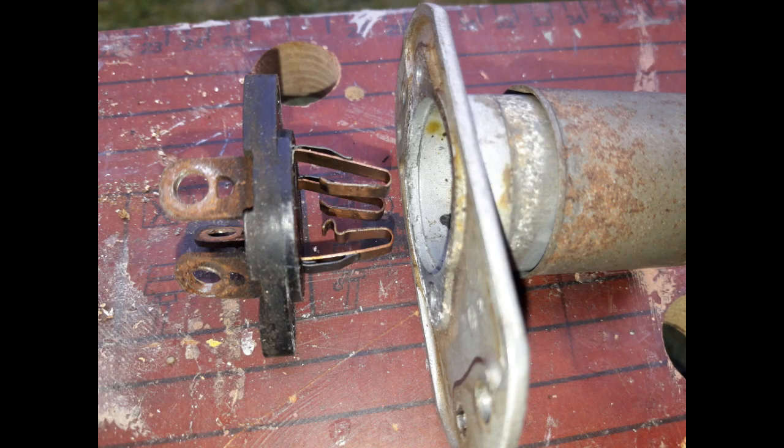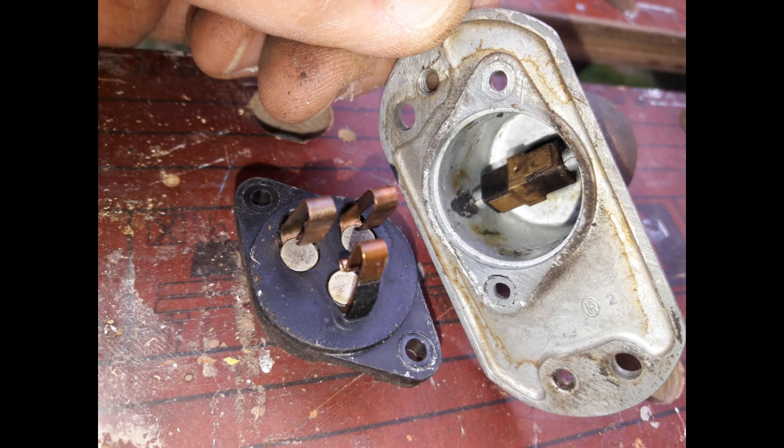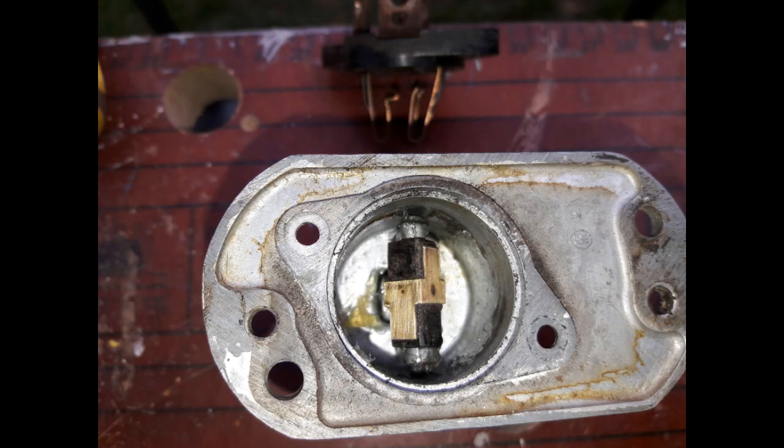There's the central input connector with the little S-shaped clip part that actuates the square — or rectangular — block that's inside. You can see the block there; it's all looking very tarnished. I can only assume that's why I wasn't getting both full and dip beam operating correctly. So we carefully clean up the contacts with fine emery paper, a contact file, or something similar.